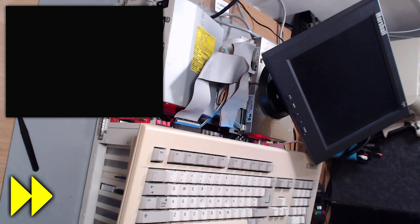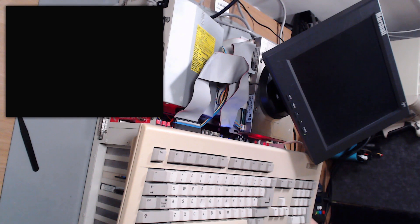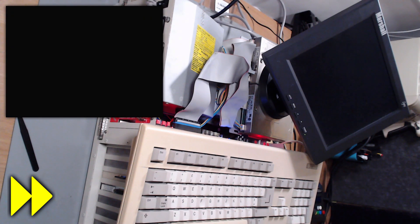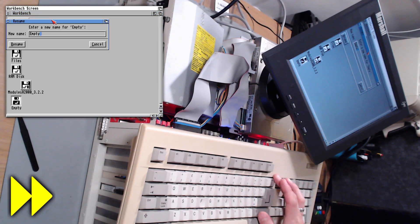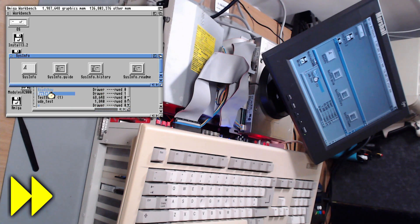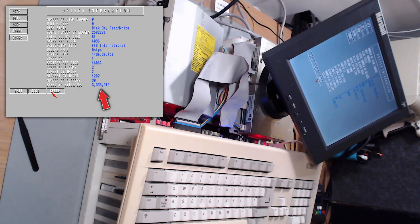And you'll notice this time it fails to boot. That error is because the partition we've just created hasn't been formatted yet, but the card's attempted to auto-boot from it. For now, I'm going to use the Early Startup menu to tell it to boot from the GVP device instead. Now booted, I'll format and initialise the drive and then rename it to Amiga, ready for installation. I want to try a quick speed test between the M.2 device and the GVP SCSI card, which currently has the Blue SCSI connected to it. Wow — so without even trying to tune it, the drive is three times faster already. That is so cool.